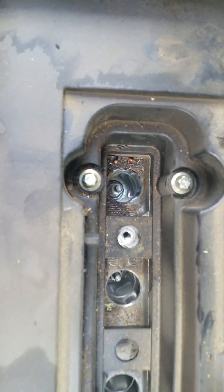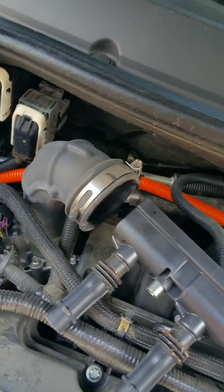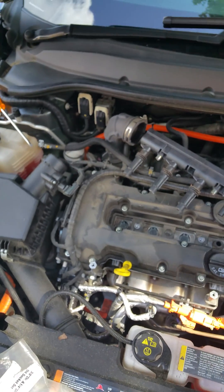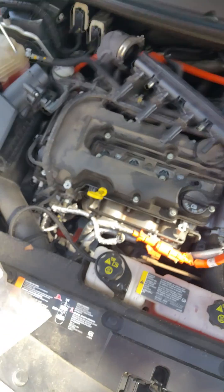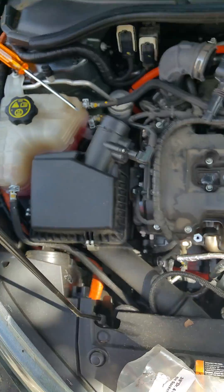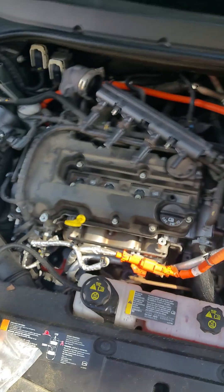All you do is simply pull out the four plugs, place them, put the coil pack back on, put your air box back on — make sure that you tighten your hoses back on here good and tight — and you've just changed your own plugs. Chevy wanted a hundred and sixty dollars at my local dealer to do the plugs, and I basically told him to go hop in a lake. My car's got a hundred and seven thousand miles on it and I should be done here in about another 15 to 20 minutes max. This whole project shouldn't take you more than about 30 minutes, so don't let the dealer rip you off — do it yourself, you're good to go.